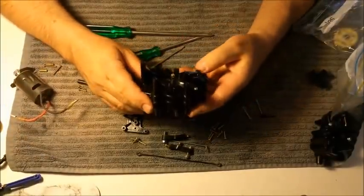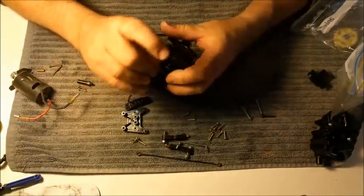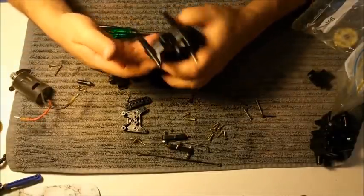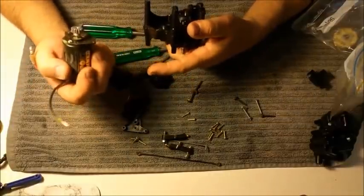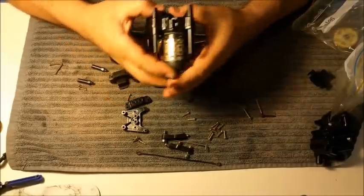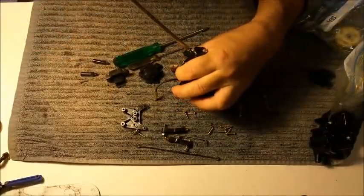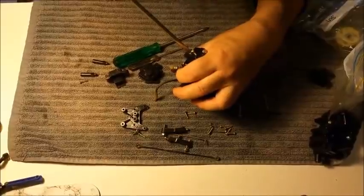As far as the back is concerned, there's a couple of things. There's the anti-crush tubes that we need to put in, which stop the casing getting all damaged when we put the motor in. Let's put that from there, that's easy. And the motor will sit, you've got to do this to a certain measurement. This one I've already set up. I can't remember what the measurement was, 15mm or something, but don't quote me on that. I'm using the long ones because obviously there's a lot of duress on this part.